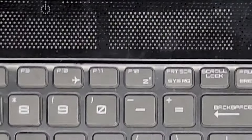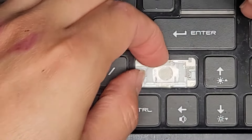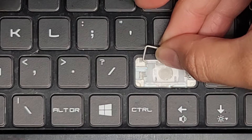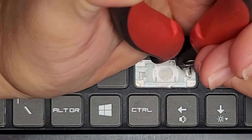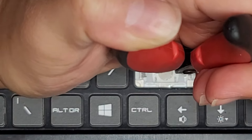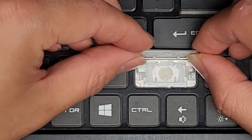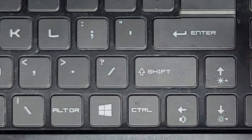We got the shift key out. We're going to take the metal bar out because the replacement has a nice new one already. These clips all look good. We're going to route the metal bar on the shift key — you can put it into the little hook area first. They bent this piece, so I'm going to bend it back. No wonder why it was cracked. I'm just going to straighten this metal piece out, then get the hooks back on — start with one hook, then get the other hook into place, center it. Get the bottom in first, then click the middle into place. We got the shift key in.